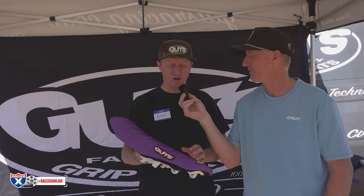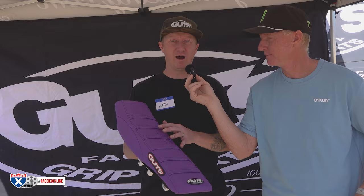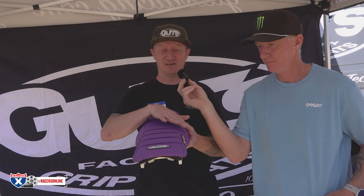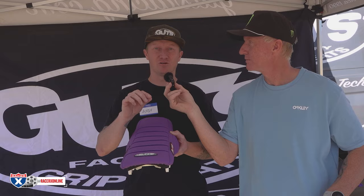We offer the stock-height in stock replacement with the rounded shape, or we have the stock-height wide — which is what this is. If you have the Yamaha, you can see it's really flat, more traditional like the 2022 model. In the wider version we offer a plus-14mm taller option that already comes wide, and a plus-25mm that's also wider. Both taller options only come in the wider shape. I prefer the flat foam — it's a little easier when you're pushing on the flat corner to get weight down on your outside peg, and if you ride a long time you just want a friendlier seat.